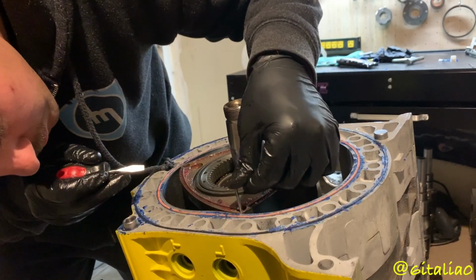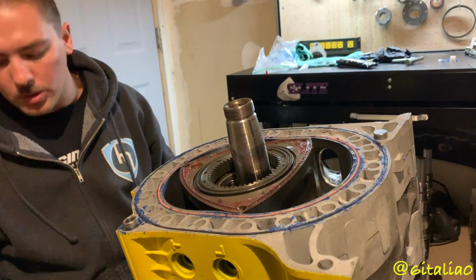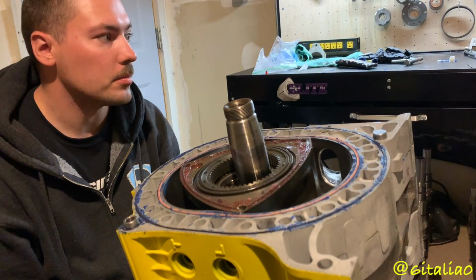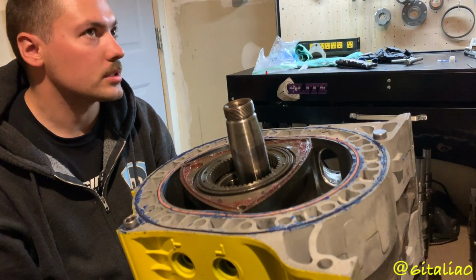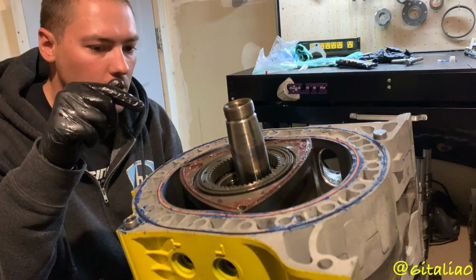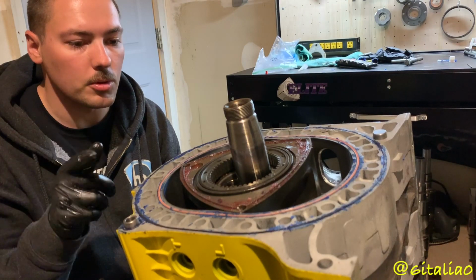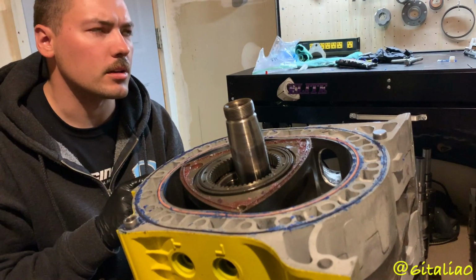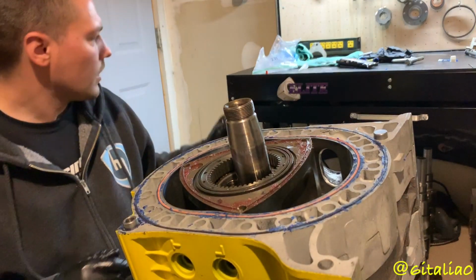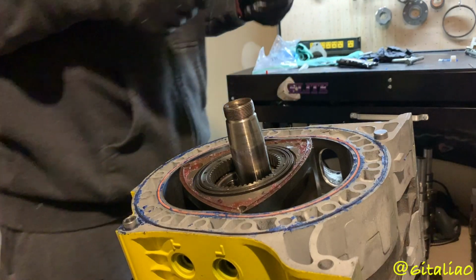But then they have the same compression, right? Yeah, the Series 5 turbo has a 9.0 to 1 compression, and same with the REW. And the rotor weights stayed the same the whole time. I see between the NA, NA S5, Turbo 2 S5, and REW rotors, they're all the same weight. I think Cosmo 20V rotors are the same weight too. Yeah, but these are the highest compression RX-7 rotors.